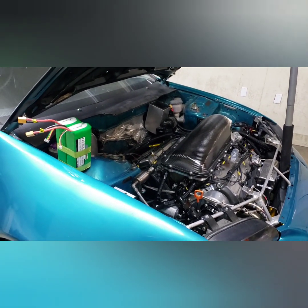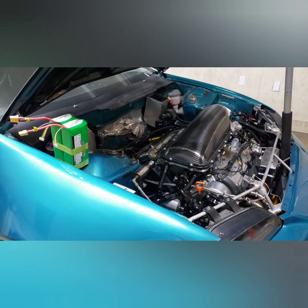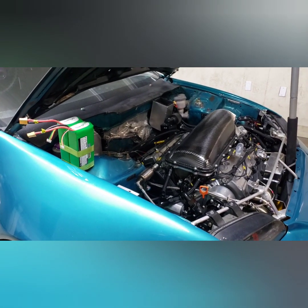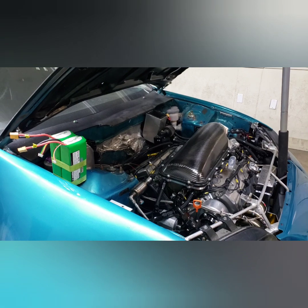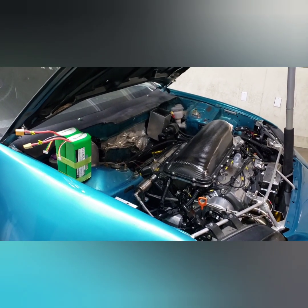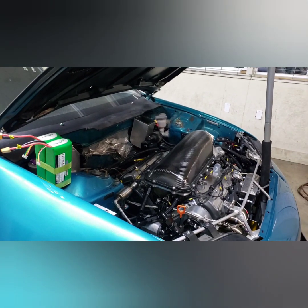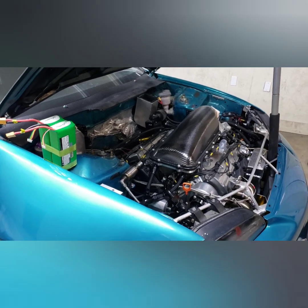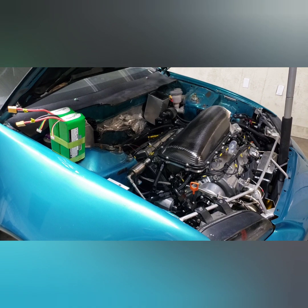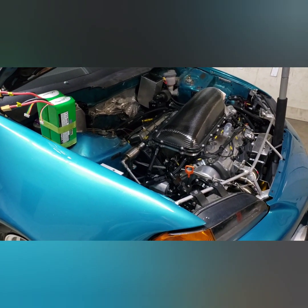You have to have a good charger, you have to have multiple battery packs, and you have to have a generator when you're at the track — so it's not hassle-free, it does require a good plan. We run enough of our cars that way that we can split the costs between the charger, the power supply, and the generators onboard the semi, so it works out for us. But it might not work out for everybody else, and my advice is to truly stay on an alternator unless you have a specific reason to do something different.